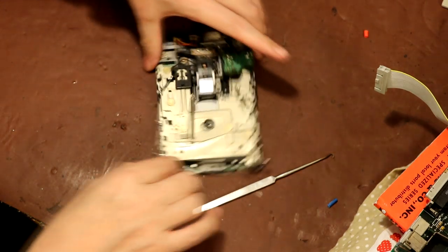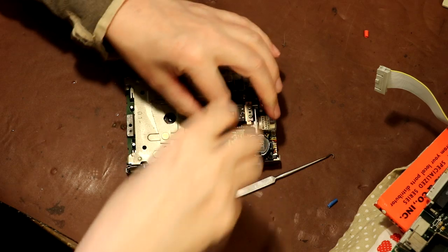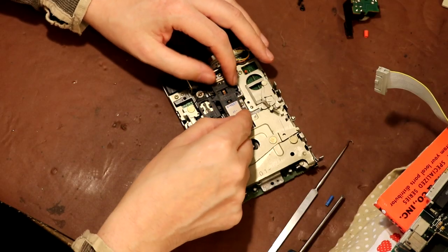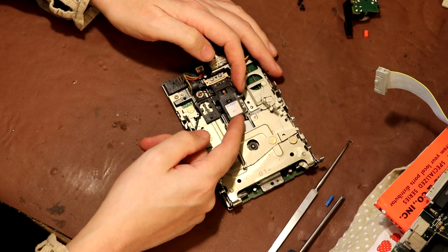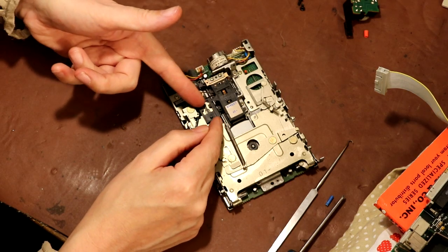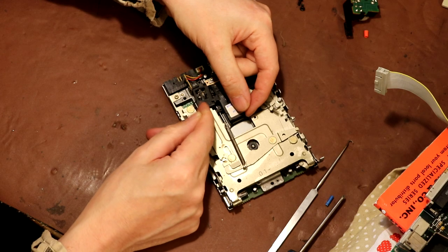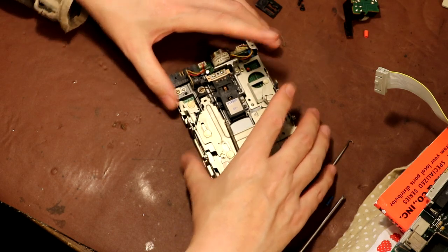That's one spring out, let's get the second spring out. Next I'm going to remove the ejection mechanism — there's a connector you wrestle off. Get that out of the way. There's a little piece of plastic here — you slightly lift up the head. This is a really dangerous bit: there are springs on these heads and if you start forcing this thing back really hard you will damage the springs and break the disk drive head. So you've got to be very careful. There's a little plastic clip which I'm going to lift up, slide it back, just lift the head slightly to get this clip off, push it back and it comes off. Now it's just a matter of wrestling this carriage out — and it just comes out like that.